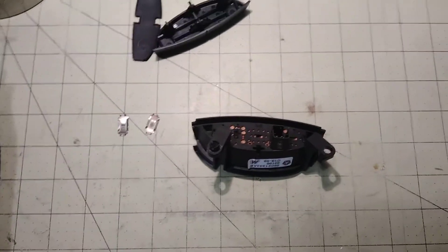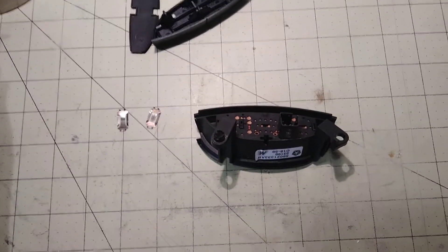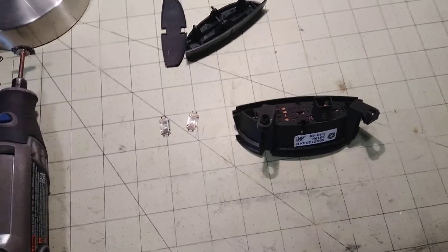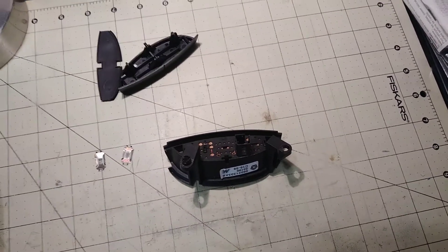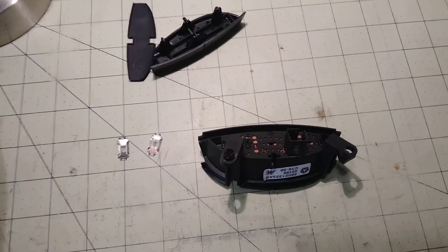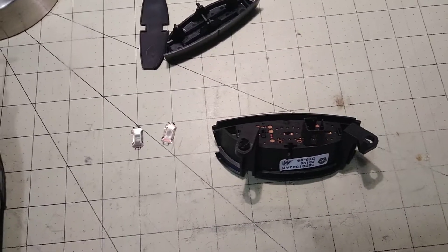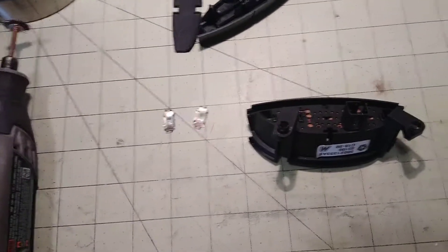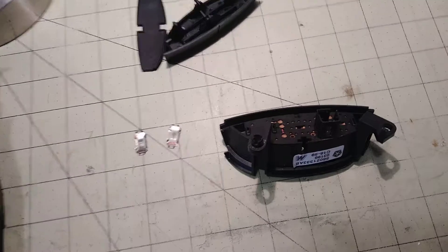You should see about 5.2 volts on your signal voltage, and then you have your sensor ground. When you test your signal voltage, I put my negative lead on the door latch in the door jamb, because I don't think the sensor ground is going to be a good reference for testing sensor voltage. When I ohm-tested from the door jamb to the sensor ground, I wasn't getting zero ohms — it was like 370 ohms or 370k.